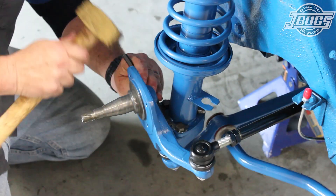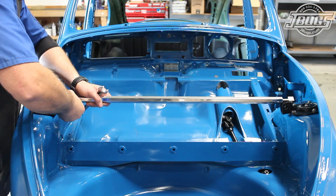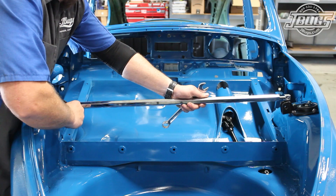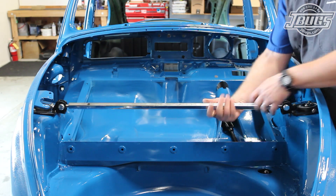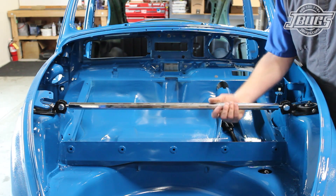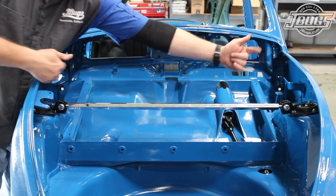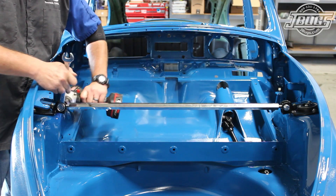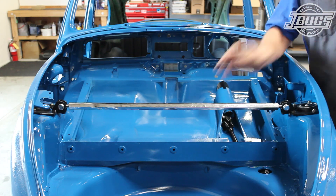The same process is followed on the left-hand side strut assembly. Then in the trunk, we thread in the end links for the strut brace and into the crossbar an equal amount. A bolt is inserted through the right bracket and link, and while holding the opposite link, the cross brace is shortened until the opposite link lines up with the bracket on the left side. The bolt is inserted there, and while rotating the bar, we can see the body actually move by shortening or lengthening the crossbar. This crossbar we installed is a chrome plated hex bar, which came in as a fluke — the crossbars that normally come with the brace are a round tube steel bar. With the crossbar set in the neutral position, we tighten the bracket bolts at both sides, which locks the adjustment of the cross brace.